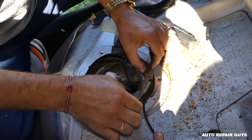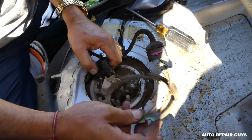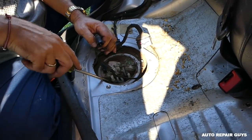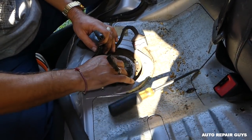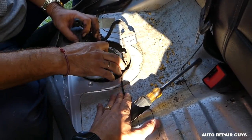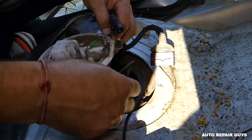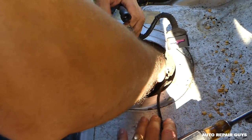Now we'll get a screwdriver and a hammer and turn the lock ring counterclockwise — it will come loose. It's a little bit stuck due to the seal, but eventually it will start moving. You can see that's the bottom fuel pump assembly there.